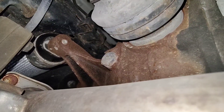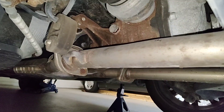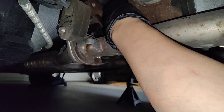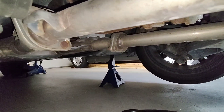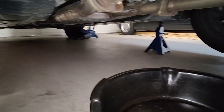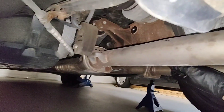The fill plug is right there and looks pretty much about the same. I want to crack the fill plug loose first and then crack that drain plug loose. I was able to crack that fill plug loose and I'm just going to remove it and see if anything dribbles out. I jacked up the front side compared to the back, so I'm pretty level and curious what comes out.